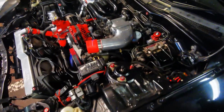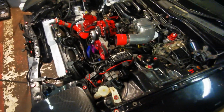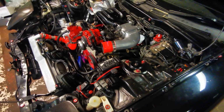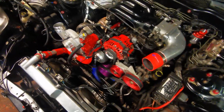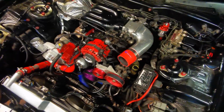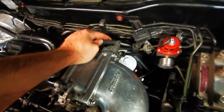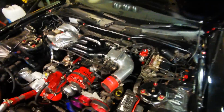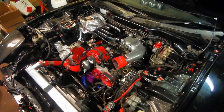So that's oil on full, although when we start it up and it starts to go through the coolers on the front, that'll drop. So we'll check that a couple of times after the first start and a couple of starts after that. Coolant's in. It's not took much, but these are a nightmare to bleed. So you pull this pipe off the back for the thermal pellet, and then you get water out of there, and that's the highest point, so you know you got the air out. But we'll bleed that up again once we know it's running.